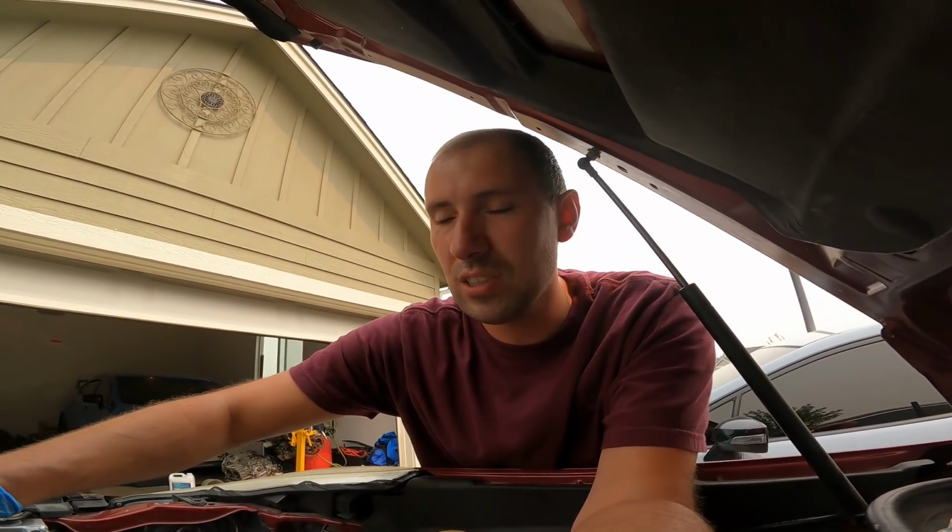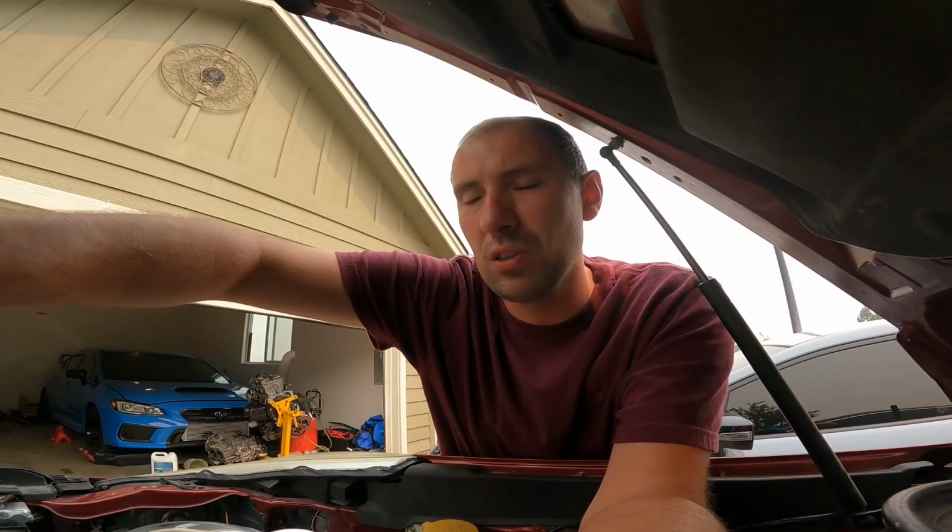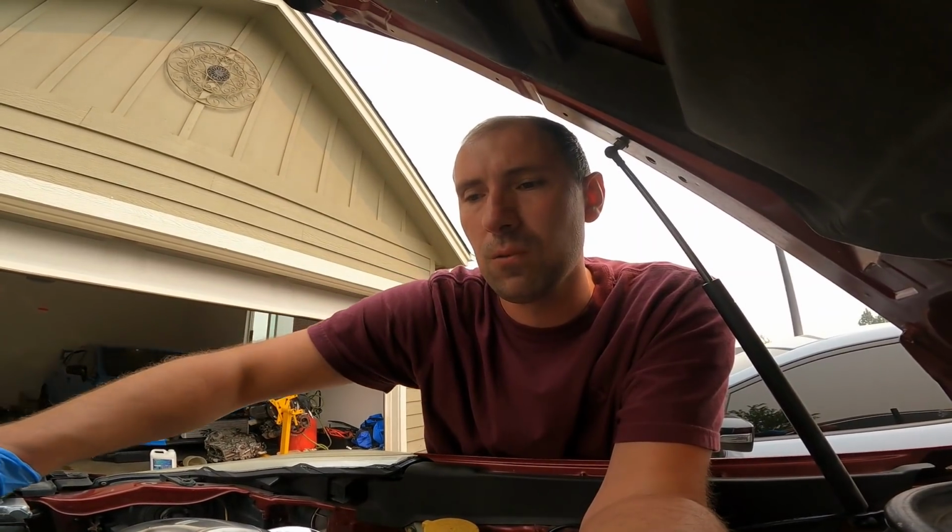It was in a full weight 2017 STI, with this turbo, the GTX 3576 Gen 2. And the car went 10.37 at 134. I always get those backwards. But we hold the record for that. That was with a pretty bad 60 foot too, like a 1.69. Knowing what we know now, if I would have got that car to go a 1.46 60 foot, that car would have gone a 9 second pass on just plain old pump 92 octane. No additives, no meth injection, no bullshit like that.